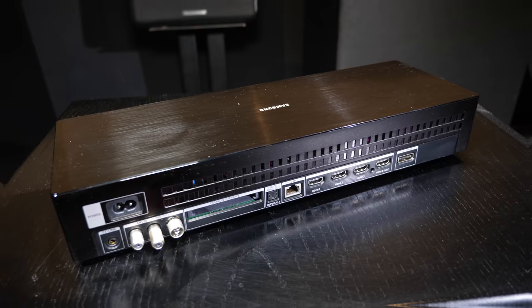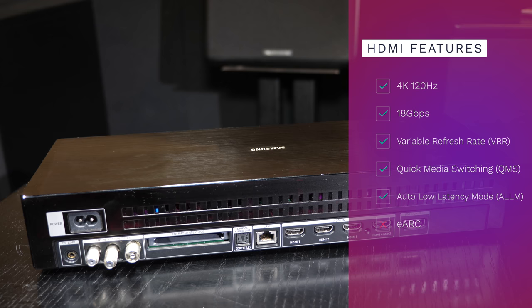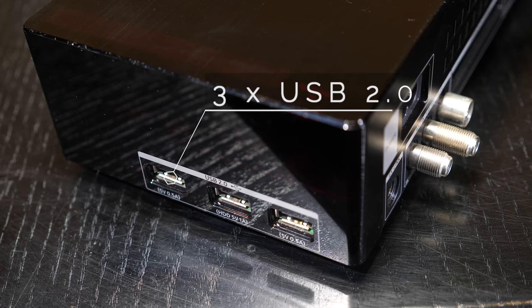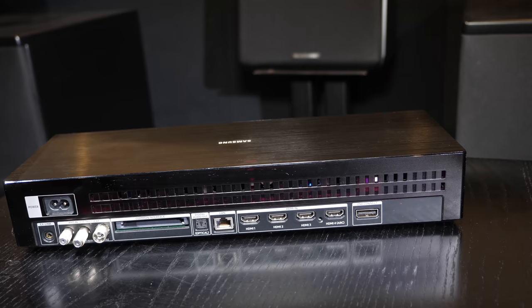While these are not HDMI 2.1 connectors, they do support many expected 2.1 features such as low latency mode, 120fps 4K with 4:2:0 chroma, FreeSync VRR, and game switching mode. The only real functionality missing is support for eARC — this could be added without HDMI 2.1 but Samsung doesn't yet see it as important. Also in the One Connect box are three USB inputs, one designed for HDD recording, along with a wired Ethernet port, optical audio out, and two satellite and one terrestrial antenna inputs. Finally there's the One Connect port which takes source signals and power to the TV.